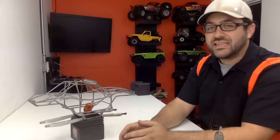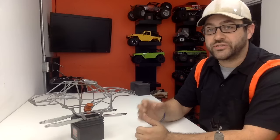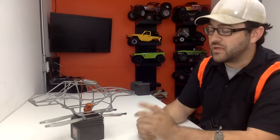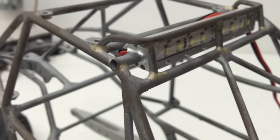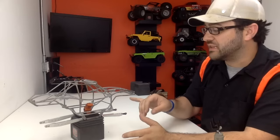This is the HD version of the PRT — PRT stands for Pure Race Truck, HD for Heavy Duty. What heavy duty means is that this is made from solid rod rather than chromoly tubing like he uses on his other chassis. On his other chassis he brazes everything; on this one it's mainly MIG welded and cleaned up. The brazing is done on the light bar I had added, but other than that everything is MIG welded — and everything is still extremely clean with lots of cleanup to make it look great.